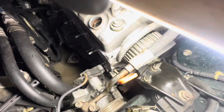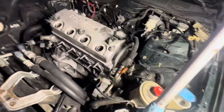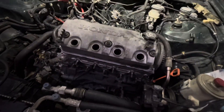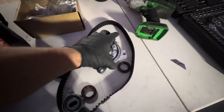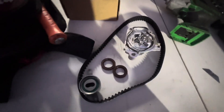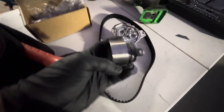I do have to take off that crank pulley. I don't know if I'm going to be taking off the tire, but I know I have to jack up the engine and support it at least. Let's go ahead and open this box up and see what actually came in it. What came with it: timing belt, water pump, two seals — not sure what they are for, might be for the cam gear — one possibly for the oil pump, and it also came with the tensioner. Let's go ahead and start tearing it down. Put a two-by-four to support the engine so we can remove the motor mount.